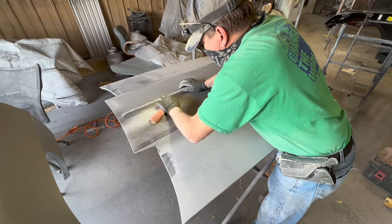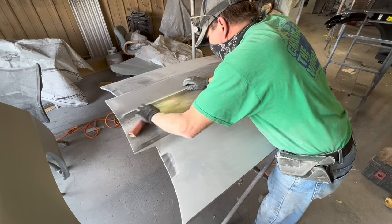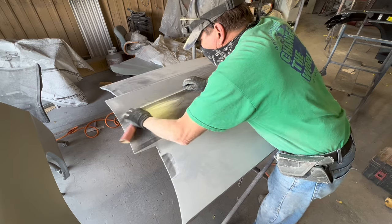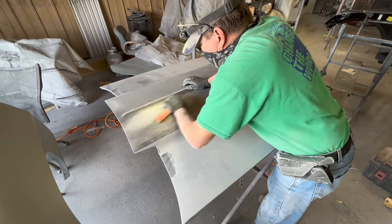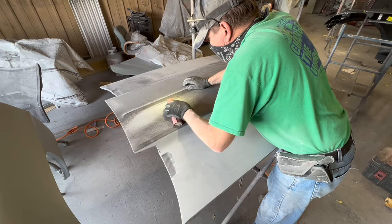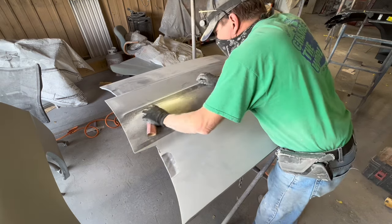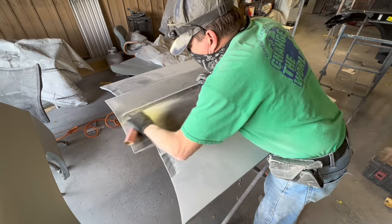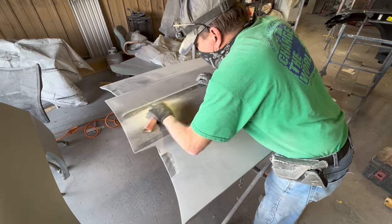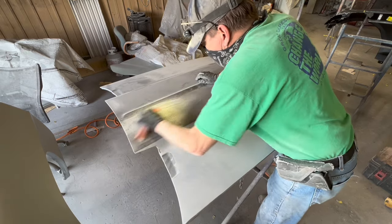so that I can fix, so to speak, the undercut of the round block that I used last time, the round block being too big for the actual reverse curve. That's a fairly small reverse curve, actually not as small as the one at the base of the hood scoop. That one was real small, and the DuraBlock round block did damage there.